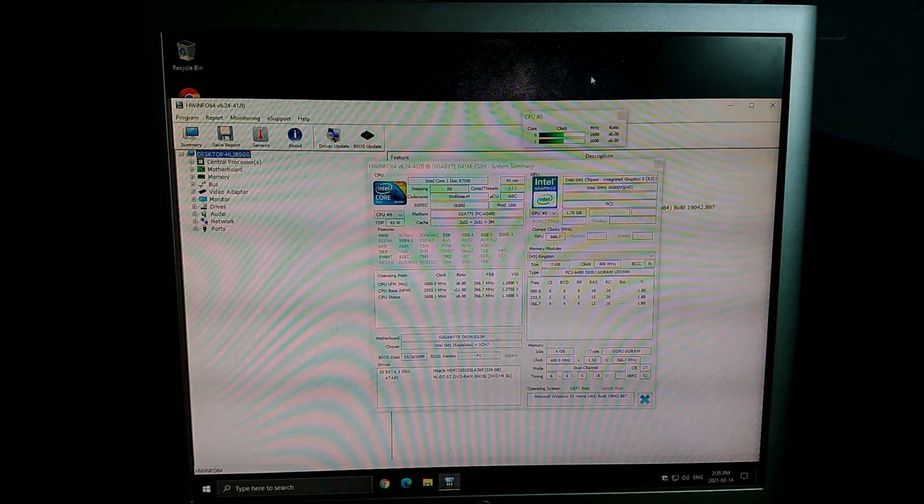And then we've got 4 gig of RAM. So there's a pair of DDR2 SDRAM chips in there. So again, DDR2 not really the fastest memory. There is DDR3 based LGA 775 boards out there, but in this case this Gigabyte board is not that, so we're stuck with the DDR2s, but it still runs okay. And then storage wise, we've got that 320 gig Hitachi hard drive.